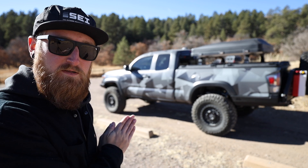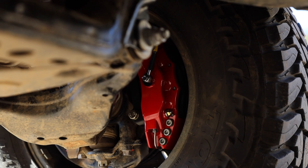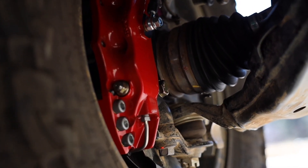The most common thing you'll see people doing is just upgrading the front brakes to a four-piston setup. The stock brakes in the rear on the Tacoma are a drum brake setup, which is fine for off-roading, but I like to have that little bit of security knowing I'm able to stop this truck whenever I want. So we not only upgraded the front to a big brake setup, but we also upgraded the rear to a disc big brake setup. I opted for a six-piston setup up front with bigger rotors. I've got StopTech calipers in there — they are bright red. Given my wheel choice, you can't really see them unless you get underneath the truck, but it is insanely functional.